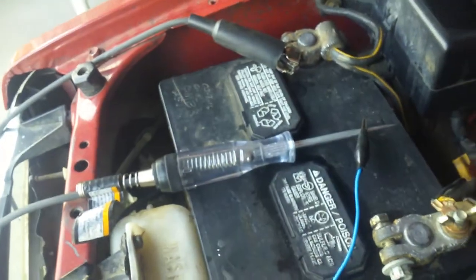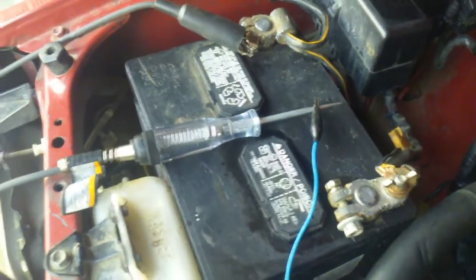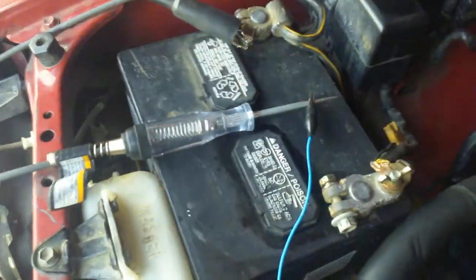Connected, disconnected — it's supposed to be like that on all four injectors. As soon as I plug number two in, it lit up. So that's telling me number two is shorted out. You're going to need a set of injectors. You can see that reads one thousand nine hundred and twenty-seven — that's almost two grand on those injectors.